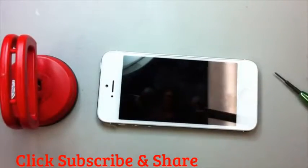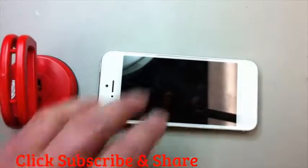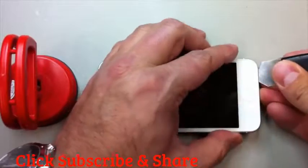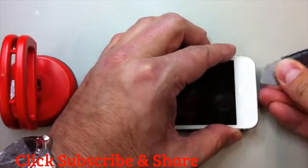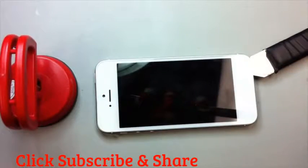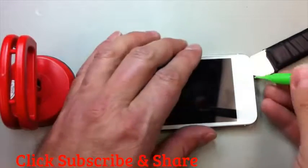The tricky thing about this is you want to be very careful when you're prying down here at the bottom. As I mentioned, suction cups rarely work as far as opening the phone, so you're going to actually go underneath the glass with your very thin pry tool very carefully. Whenever you're working with metal on glass, you want to make sure you don't put too much stress on it.